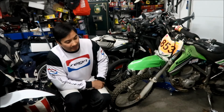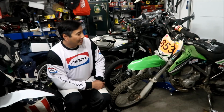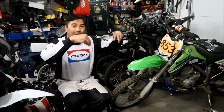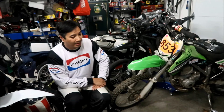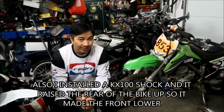Man, yeah, just ride the bike harder. I was just not riding the bike hard enough. Before the race, what I should have done is lifted the front up, or pushed the forks down into the triple clamps. I should have done that. I forgot I had the bike set up for Super Moto.